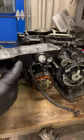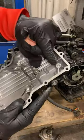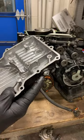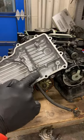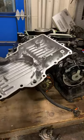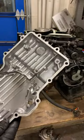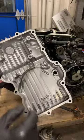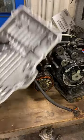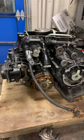So the engine oil, this is a return line here that was squirting oil in here, and this is a little bit of a labyrinth for the return oil to do all its splashing and foaming and frothing. Any sediment, well, this is not gold mining, but you can think of it as a sluice box. Any sediment will settle in these grooves. This is obviously non-magnetic aluminum casting, soft. So there.